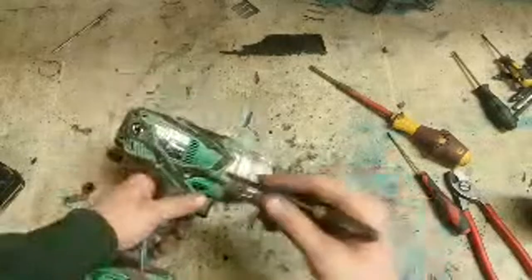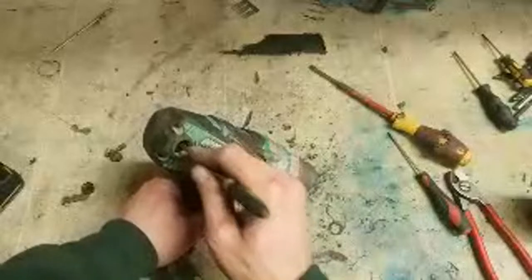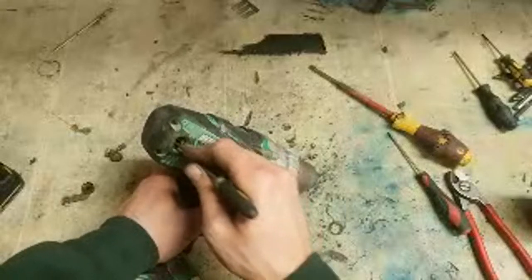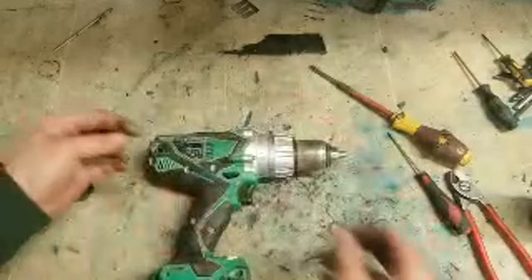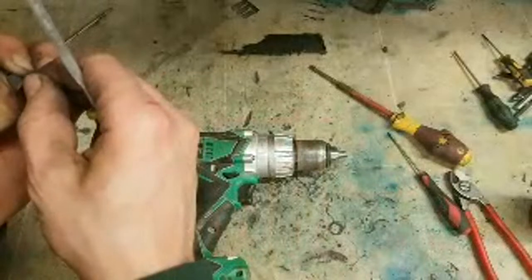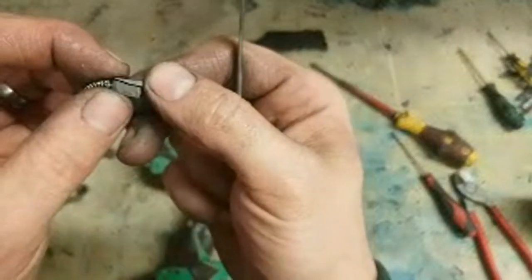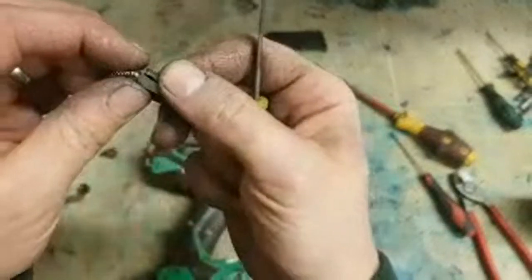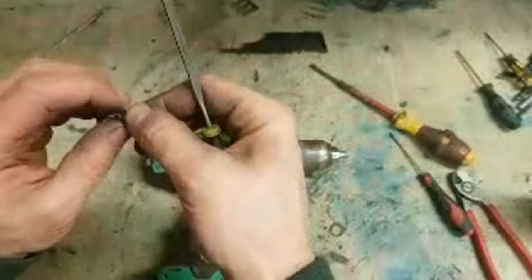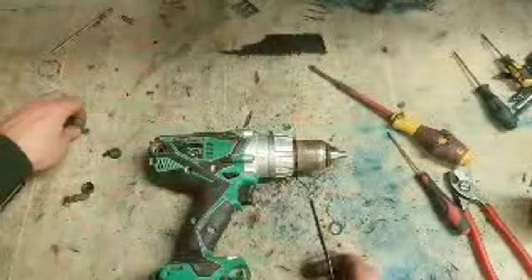Now you can change that holder as well if you want. But change the holder and the brushes, you're onto about 40 or 50 quid just for that. To be honest, it's not really worth it. 5 or 10 euro. Clean out these here brushes. There's the main problem. The one's got too much heat. She's actually broken. So that's the main reason why she's very tight. We've a hairline crack running up. So it's expanded as well. So those brushes are actually gone on that.